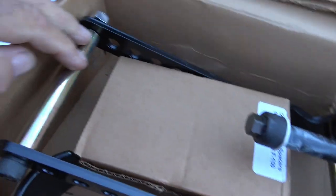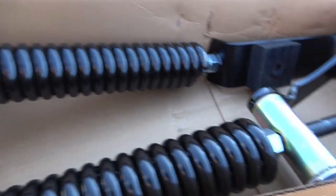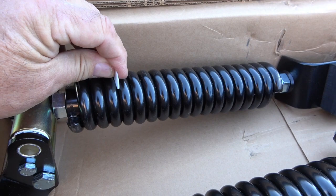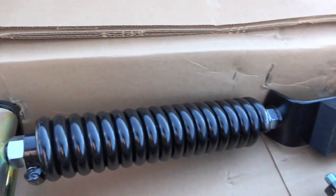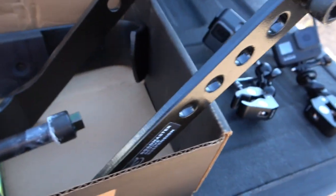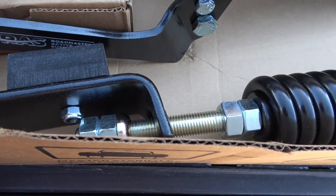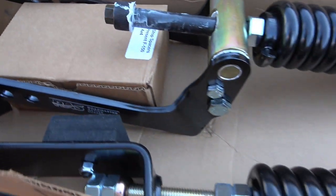They're all assembled. All you do is lay them in there, take the bolt out and let it drop down, then adjust the spring. I think the black disc is 2 millimeter and the other one is 1 millimeter — that's how you decide how much tension you'll have on your coil. The wider the space, the more rebound; the tighter the spring, the less squat. It's all greased up and ready to go.